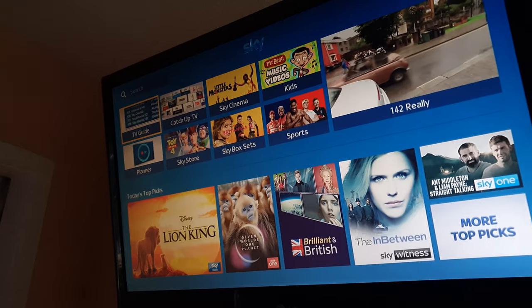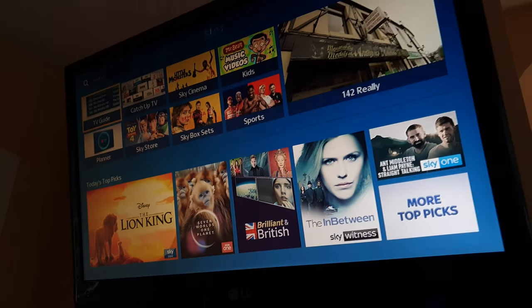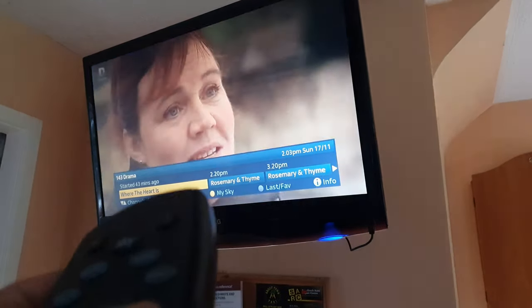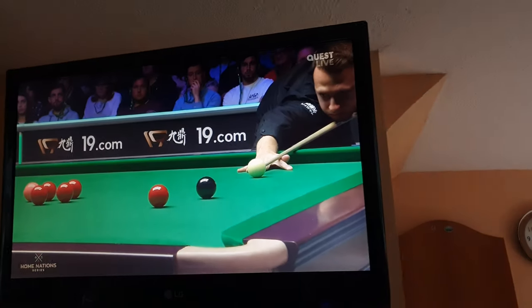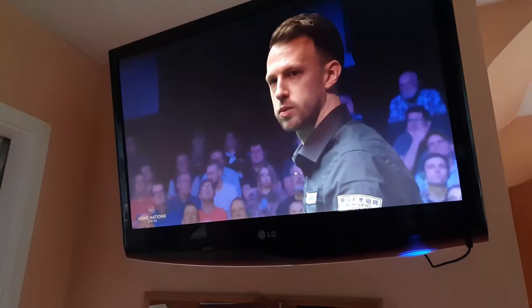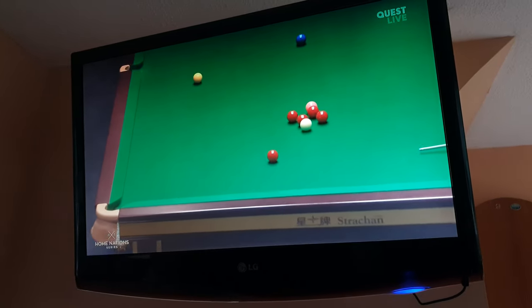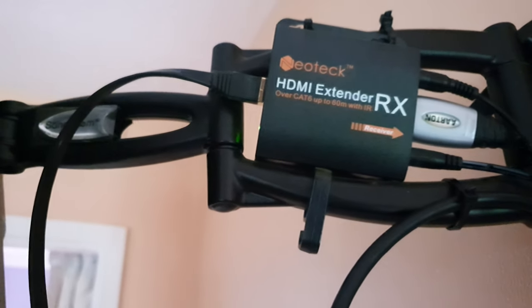Around the front of the TV we can see the IR blaster, and the picture quality on that is absolutely fantastic - no snow, no interference when people are walking around, no interference when other devices are on. Because I've got the IR blaster, I've got the Sky remote control here and I can literally sit here and flick through my channels. Obviously this is changing channels on the main TV as well. A really simple, nice, elegant solution for those that want to extend their signal out to other devices. We've got Sky HD, we've got it upstairs as well as a multi-box setup. We also want Sky Q when that gets put in - we just wanted the direct feed into the TV without having to add additional Sky boxes. Really simple, elegant solution at a stupidly dirt cheap price. Lossless signal - brilliant.